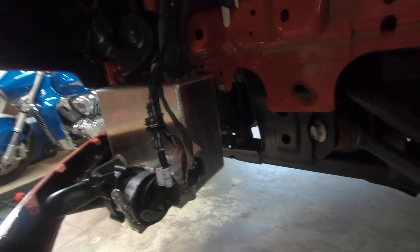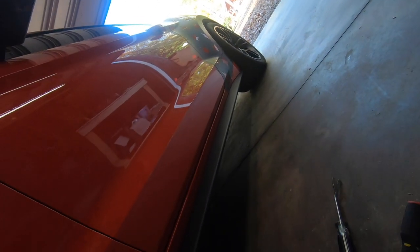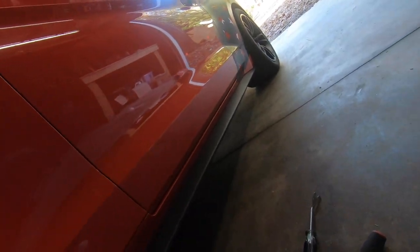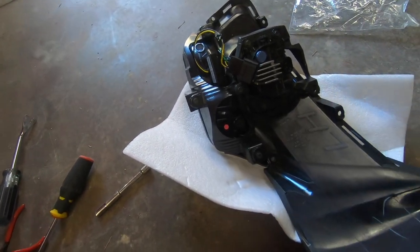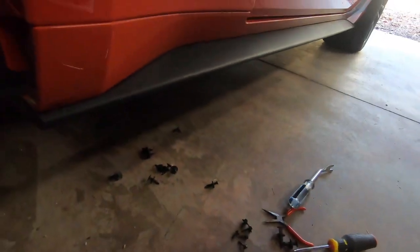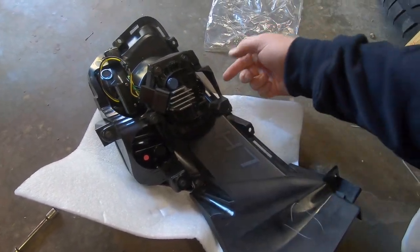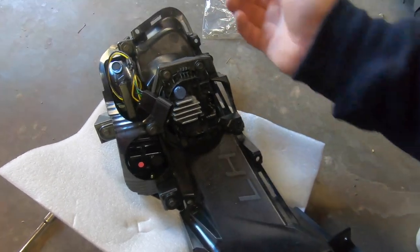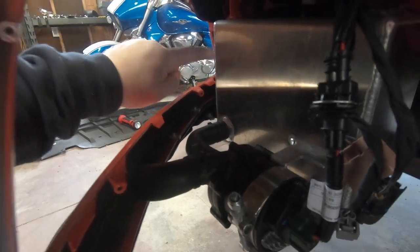We're back and as you can see I've got the fender liner completely out. Here you can see this is the tank for the Whipple right here. That big hole right there is where the whole fog light turn signal assembly is, and this is it right here. What we did was take out some screws — a screw here, here, here, here, and here on the inside of the car. With some finagling with wrenches I was able to get all those out, then this whole assembly pulls out. You can see some notches here, along underneath here, and along here, and there are these tabs in the car.